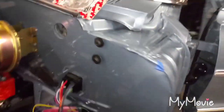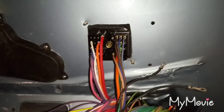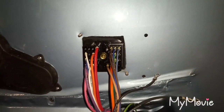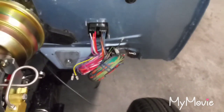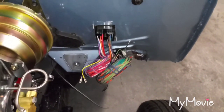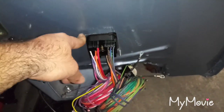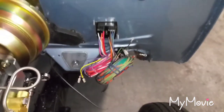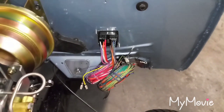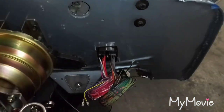I ended up cutting it and got it to fit, but I'm not too excited about the cut — it's crooked. The first cut I made was much more square, but once you try to cut an already-existing hole bigger freehand, it's hard to do. The other thing I don't like is the screws — it calls to screw from inside, but these things are sticking out almost an inch out of the firewall. There's got to be a better design, so I'm going to maybe get some different bolts — actual fine-thread bolts — and thread from the inside.